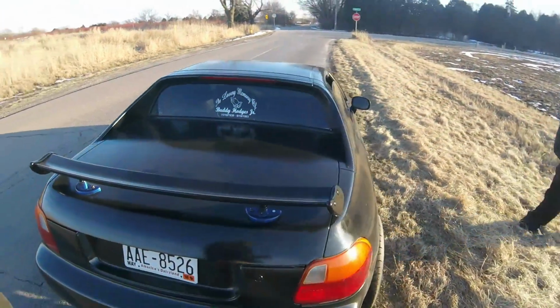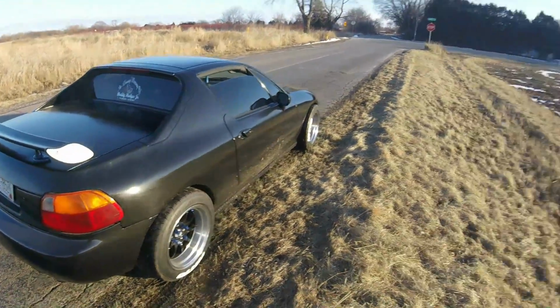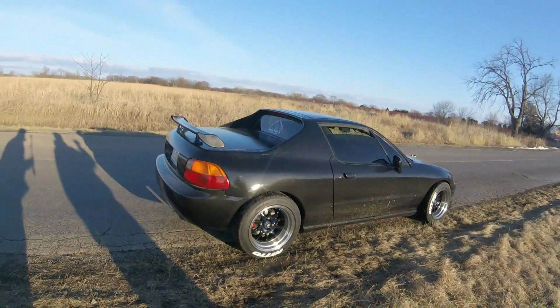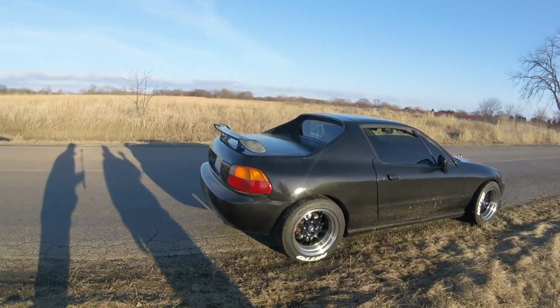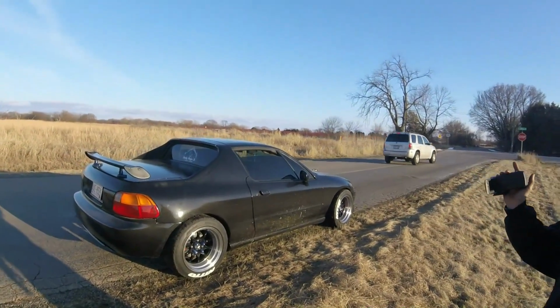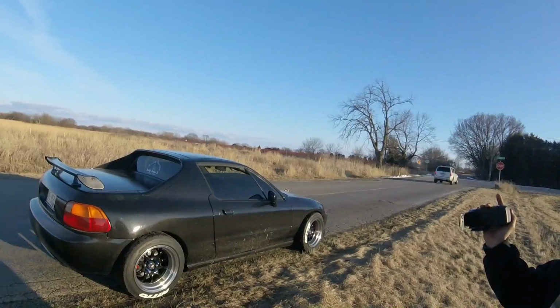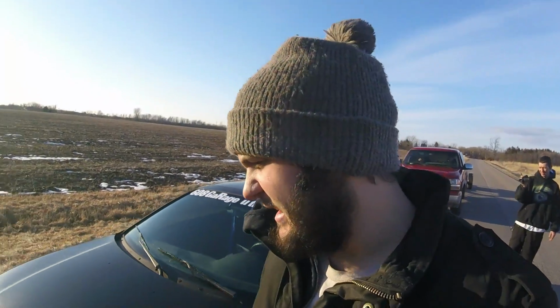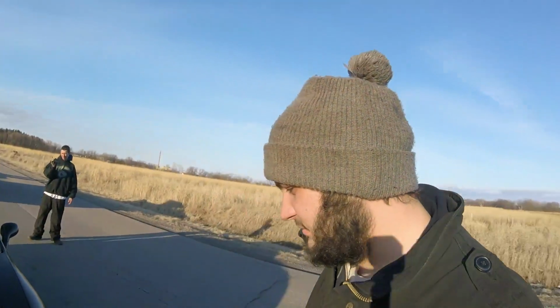But yeah, sorry we had to cut her short on this thing. But I mean, it is working a lot better now than it was. I'm happy with it for now. Yeah, I mean, at least it runs. Got everything else sorted out on it. I'll order that stage 5 clutch for it. Yep. Get the turbo and the header all done, and bring it back to you. All right. The new wastegate and all that. Yep. The wastegate's also, he put a really small spring in it, and it keeps hitting the boost cut at 15, so it definitely needs something addressed with the wastegate as well.